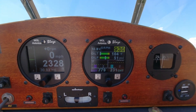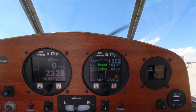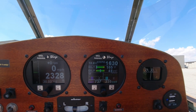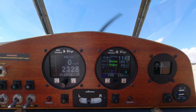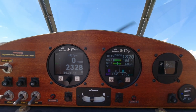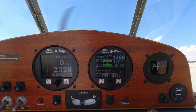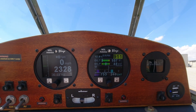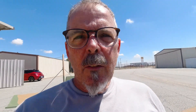I'm going to hop in the plane. The RPMs are jumping around a bit — it's kind of between 900 and 1100 and then it jumps a little bit. CHTs and EGTs look good. Of course, we're just basically idling. Oil temperature finally came up to 105; we're looking for an operating range of around 160. It's good to see the oil temperature finally started moving. The oil pressure is sitting right at 50.